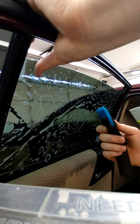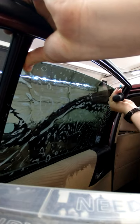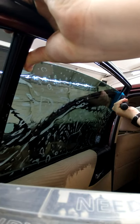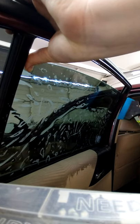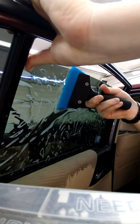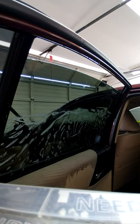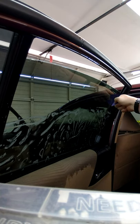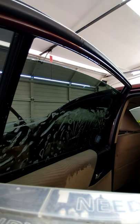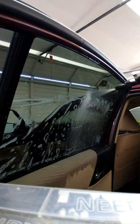Take your blue max, hold one finger on one edge, start in the middle and work your way out. Do at least two or three strokes to the side of the window, then go to the other side and push it all the way in. Take your hard card, go down to just where you squeegeed — no further — and roll your window all the way up, then spray it again.